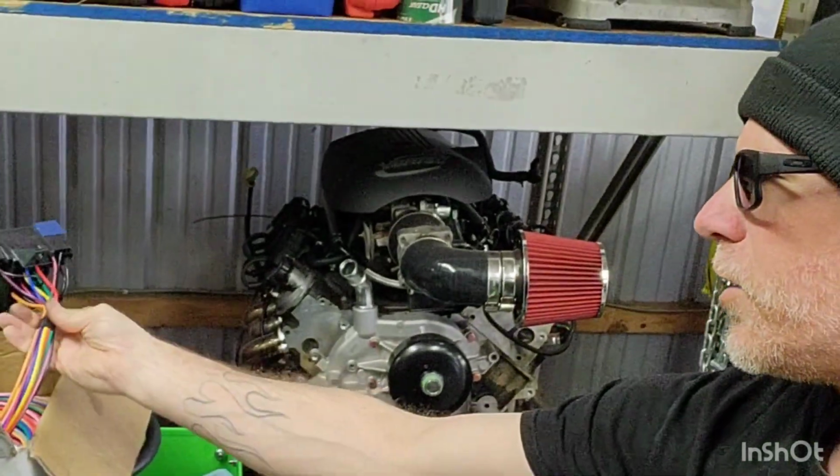I need to get our fuse box wired up. But some of you may remember my whole reasoning for cutting all that out was because I opted to go with one of these guys right here. This is a 12 unit fuse panel. Pretty neat little setup, but I decided to go a different route. Made my own panel for the five circuits that I will be running, or six circuits that I will be running up front of the truck. I can always add to it later. I'm going to put another fuse relay panel on the passenger side for the ECU, everything that kind of requires higher power draws.